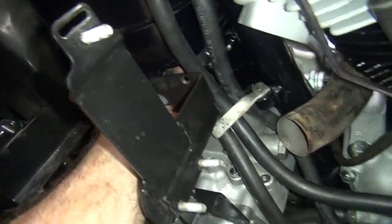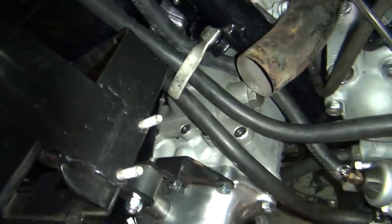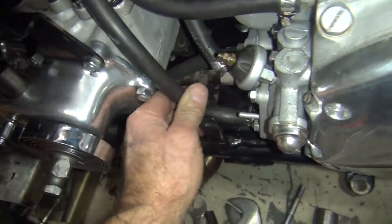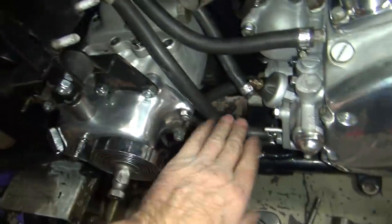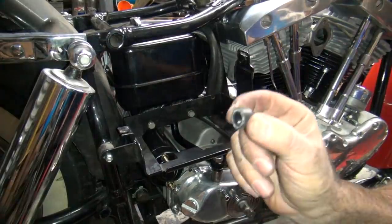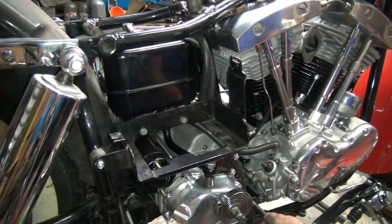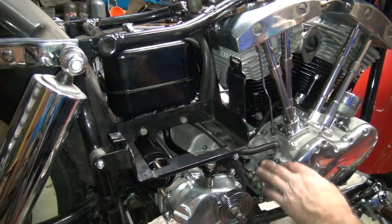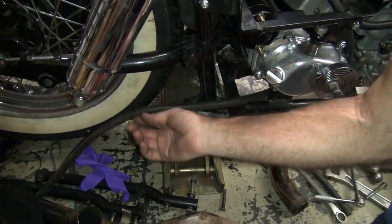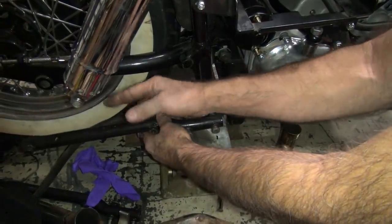It's a little short — oh well. Next time make it a half inch longer on the bottom. At least now there's room for a nut in here and it won't be eating on the lines, so we're alright. So we got the oil lines are all in there. We've got to figure out where this is going to go — we got the peak line here, the engine vent line, otherwise known as the breather line. I run out a crappy bracket back here and tuck it underneath so it stays in the back.